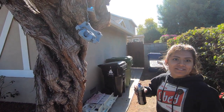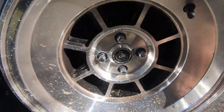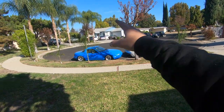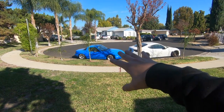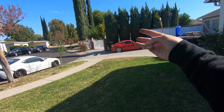Did you see that bug? It just landed right on there — it's gone now. Look at her concentration. While Alina's painting, an update: the little Miata, the Blue Boy, sat for so long that all this dirt accumulated and the pad seized up to the rotor. They're brand new brakes, maybe a year old. So as soon as this Miata is done and comes in the driveway, we'll take out the rear helper springs to make it a little bit lower and replace the rear brakes on it. We're going to paint it that color too, because the wrap is starting to come off.